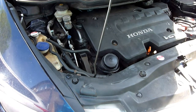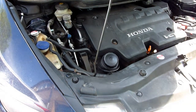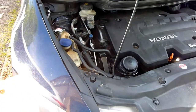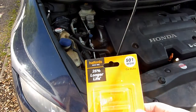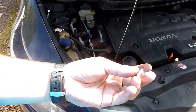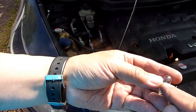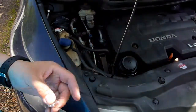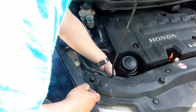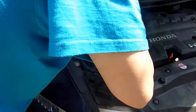You can see how it's all silvery and that's about to go. I think these are 501s — 501 W5W. You're meant to clean these to make sure there's no heat concentration on it, but look at that blackening in there. There's going to be heat concentration on that for sure. The oil from your hand is what causes heat spots.